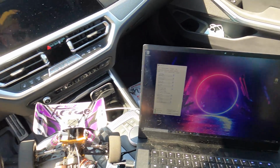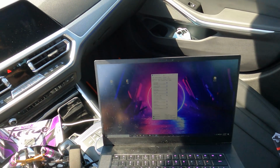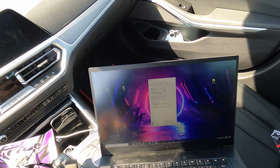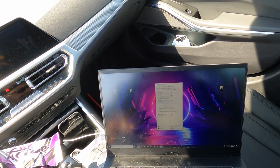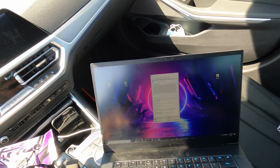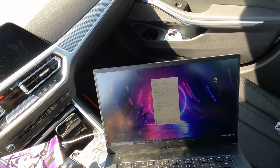So one of the cool things about modern electronic speed controls is that you can hook them up via USB and make some changes. So we're going to go to advanced. Nope, sorry. We're going to go to motor, and then bump this timing up from normal to highest. Now it'll give you a little explainer, and you know, lowest is best for bashing, like taking jumps and ripping around and stuff. Normal is good for bashing or racing, and then highest is used with extreme caution with any motor. Be sure to check motor temps often. So we'll do that,